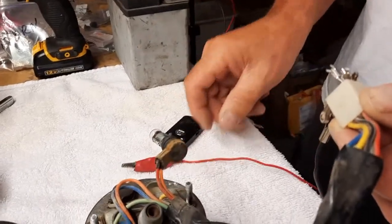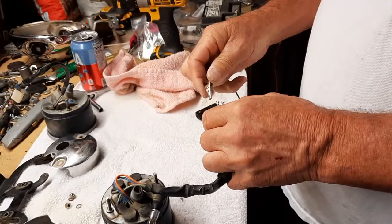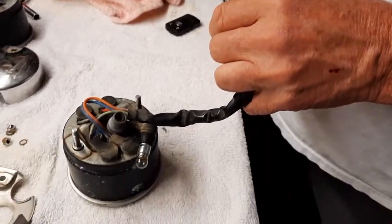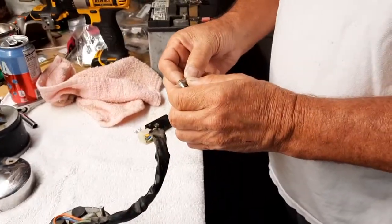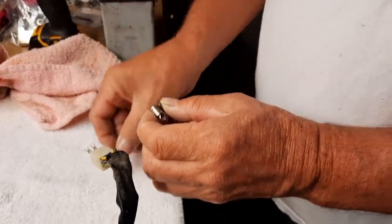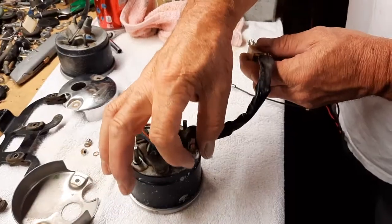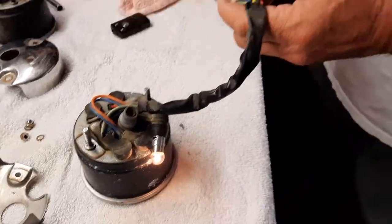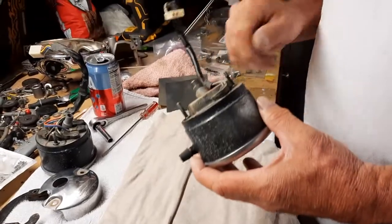So we're going to do that with every one of these other bulbs. All right, we found our first failure. No light. Nothing's happening. So let's see if the bulb's been... All right, let's see. Oh, it's the bulb. All right, we've got a bad bulb. Try to put a new bulb in. Aha! Wiring's good and bulb's good. All right, all the lights are checked out.